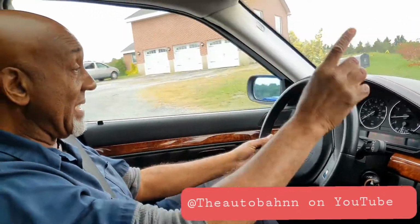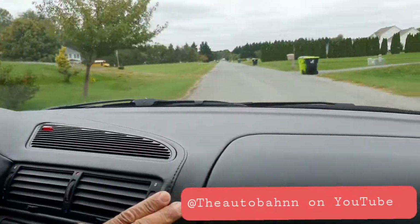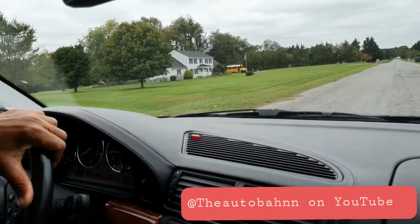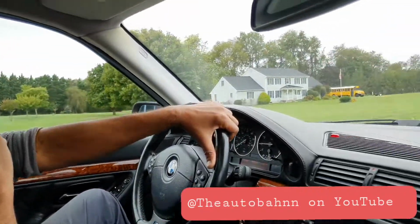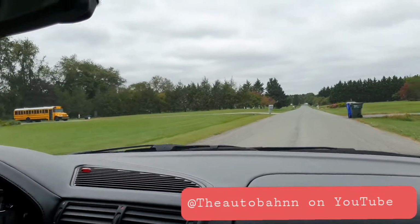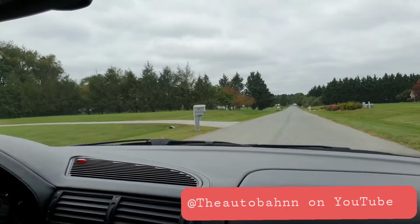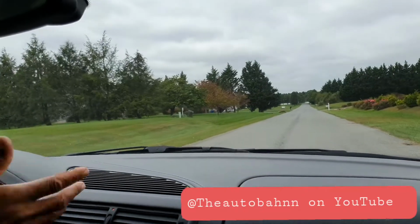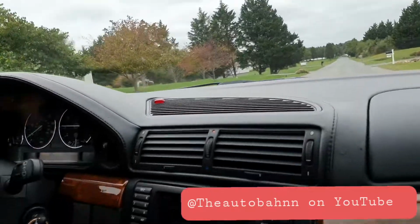Oh yeah, one more thing I did was I changed the dashboard. I like the stitching on the dashboard. And while I was in there changing the dashboard, I said, you know what, I'm going to change the blower motor and the blower motor resistor while I'm in there, only because it's a '01. It's got 252,000 miles on it, and God forbid 6 months down the road the blower motor or the resistor took a dump on me, and then I'd have to take this dash back out again. So I just went ahead and changed it while I was there.